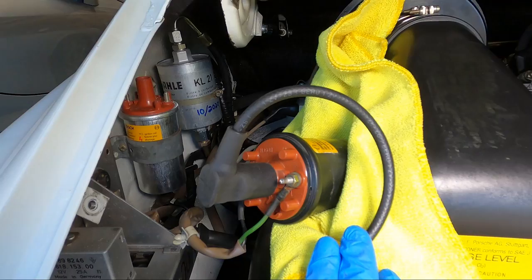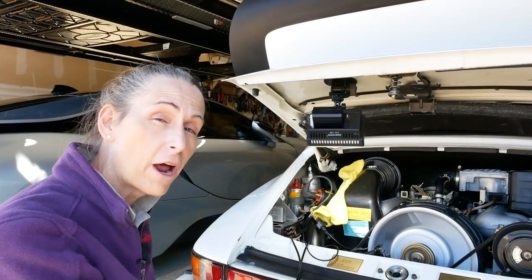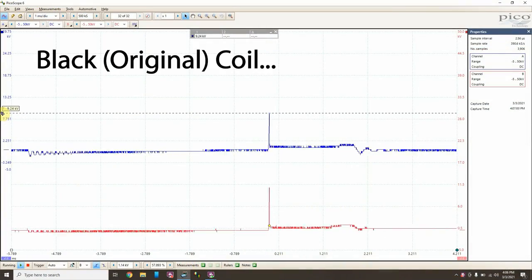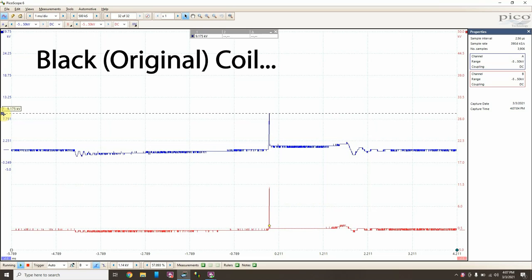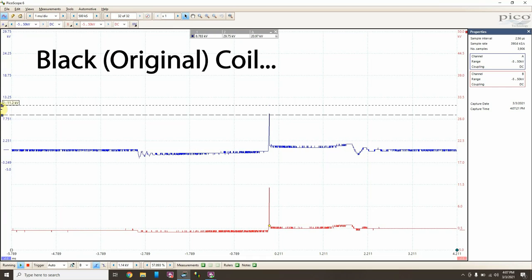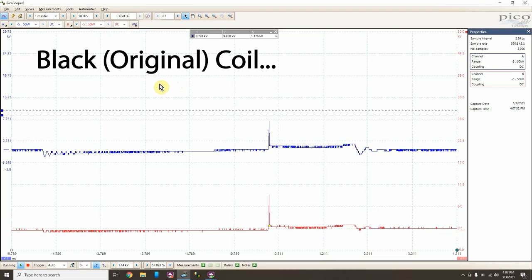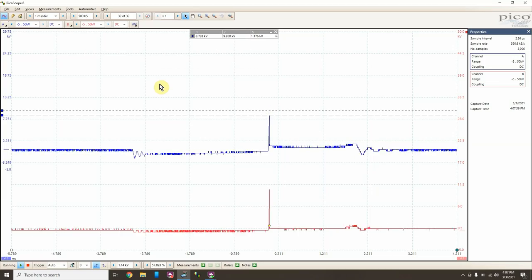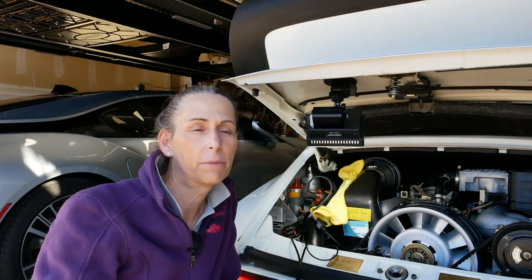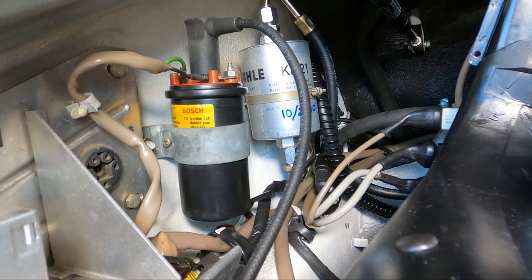I have our old black coil hooked up. We'll go ahead and start the car and get a few graphs on this to see how it's doing. We're now running on the old black coil. It looks like we're peaking somewhere around there — it's actually got a higher voltage than the other coil, around nine-ish kilovolts, although it's kind of up and down a little bit. It looks really good though. I'd say our black coil is probably in good shape. We have something finally definitive on the coil — I was just going by the color of the spark, but actually measuring its output voltage is the way to go. It looks great, so I'm going to go ahead and reinstall our black coil.